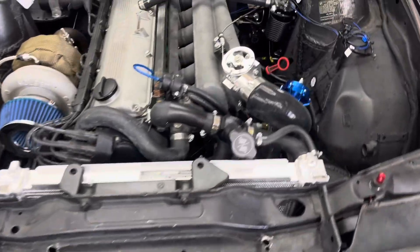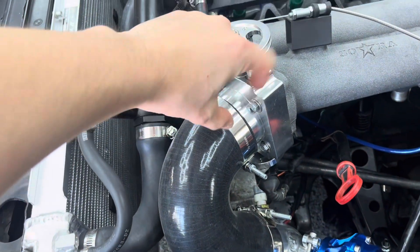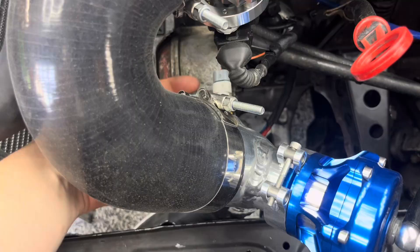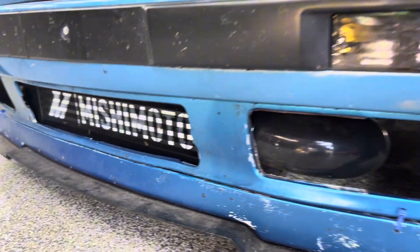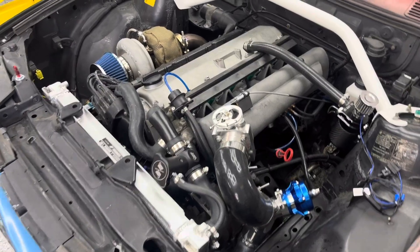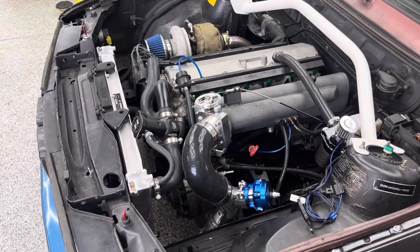On this side I have a modified 135-degree pipe — I cut a little bit off since it's supposed to be slightly longer. The blow-off valve and air intake temperature sensor are welded in there, and the blow-off valve connects to the manifold. That tucks down around the alternator right down and around the chassis — again very close but no vibrations or rubbing. That pipe connects into a 135-degree pipe into the intercooler. If you have any questions or need measurements, just let me know. This is a couple months after I recorded all that footage.